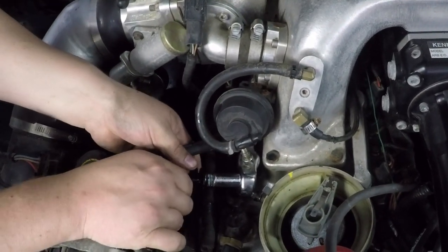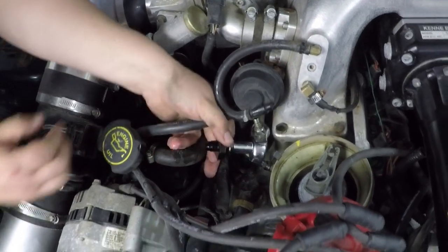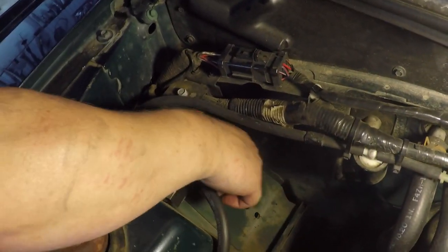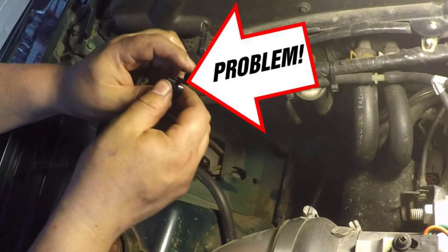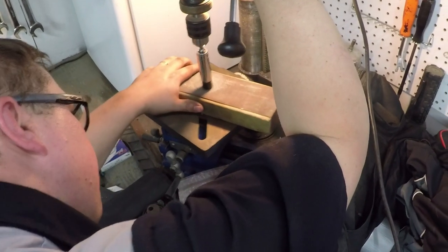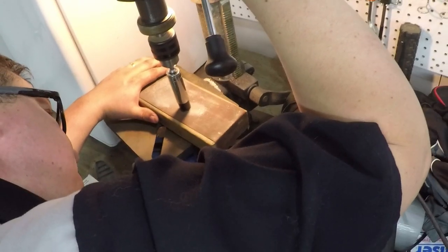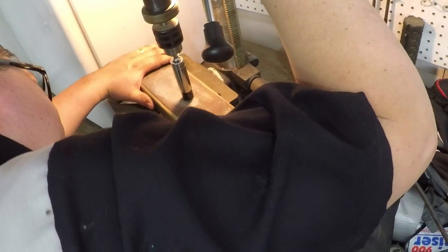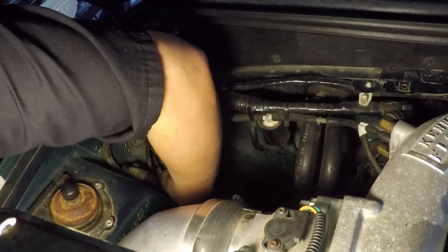With the fuel line adapter for your rail — dash-six or dash-eight, whatever you've chosen — be sure to put a little bit of grease on the O-rings to help them go in; they can be a little stubborn, but make sure they twist and push on and they will go. Now, this is where I wanted to set my adapter at the firewall onto the hard line, and this is where everything was going according to plan when suddenly there was a problem. This little piece right here is way too thick. There are two barbs on the factory fuel hard line that retain it, and the fitting wouldn't fit into the gap between them. With no parts available late in the hour, I had to resort to heavily thinning it down using a rudimentary lathe. It did work, but I don't recommend it — the crux of this video is getting the correct part numbers.